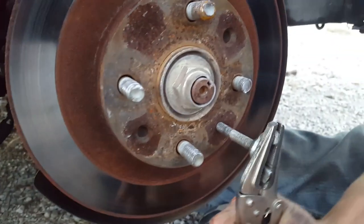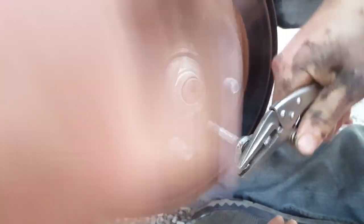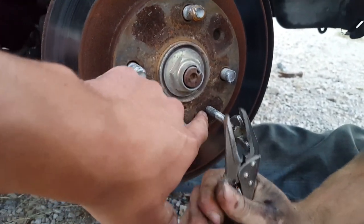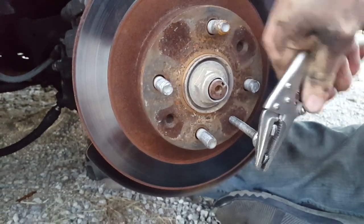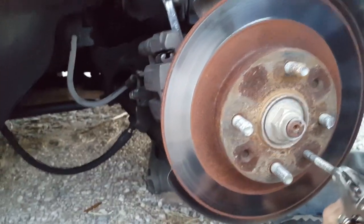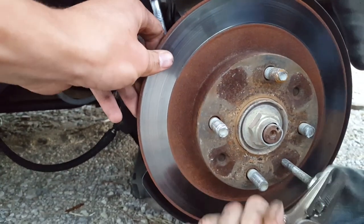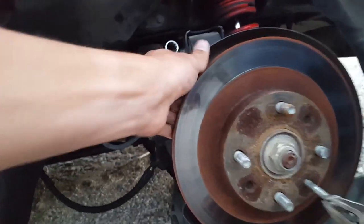There's a handy little trick — if you go in your trunk and remove the bolt used to get the spare tire screwed in, you can actually screw it into the threaded hole of the rotor and it'll pop it off. Supposedly. I think it's gonna work. It's coming off — I'll keep going. I thought you had to take this nut off but it's coming right off.